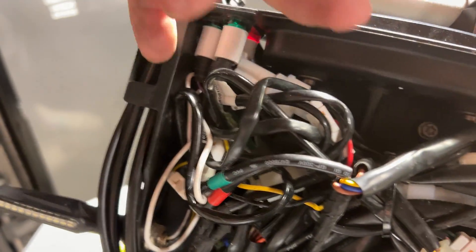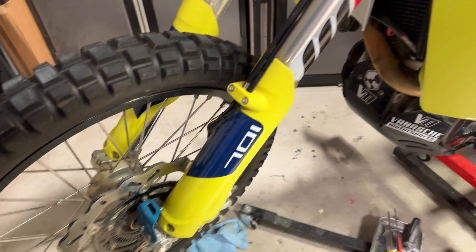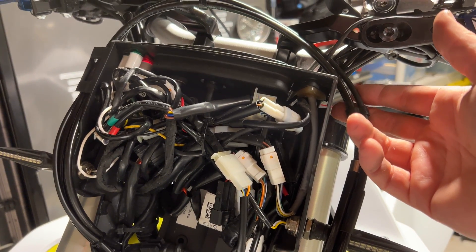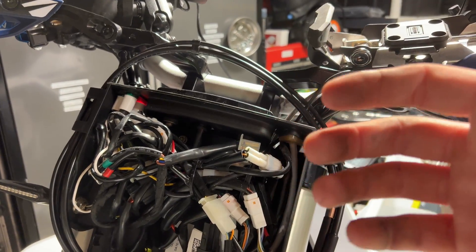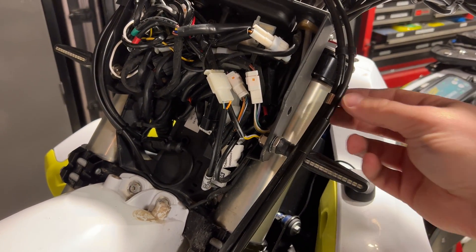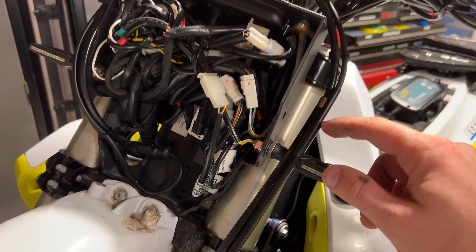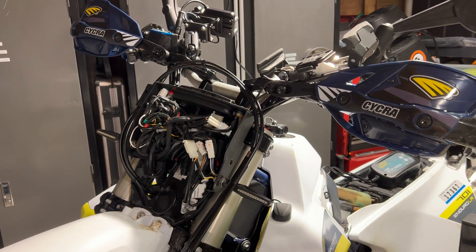So this goes back in here — here's your ABS sensor right there, wraps around nicely. There is an opening behind here so you can just fish it right in. I'll put this up as a video about a speed sensor wire breaking on a 690. The main thing is this belongs back here — if you bring it in front of the windscreen it puts a lot of stress on it and it just pulls it right there. When you fully extend doing jumps or fast speed stuff, it's going to keep breaking. I'll keep an eye on it and always keep some tape in my tool bag just in case. Thanks for watching everyone.